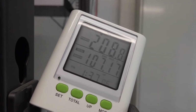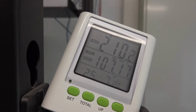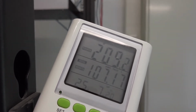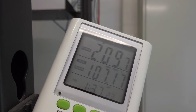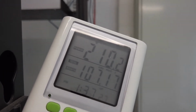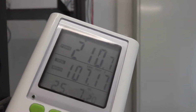One more thing I forgot to mention is the power consumption of this rack. This is everything in this rack right now: the one Cisco switch, my Synology, 2 external hard drives, the access point, the modem, the pfSense box, my admin PC, and everything runs over the UPS. Everything consumes about 210 watts.